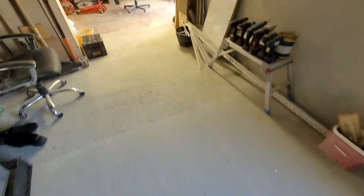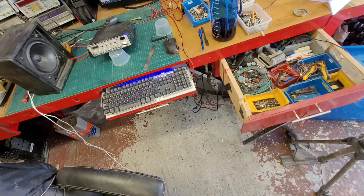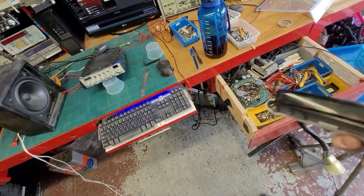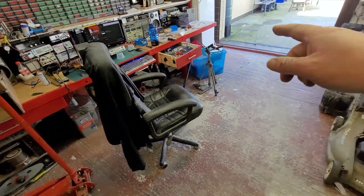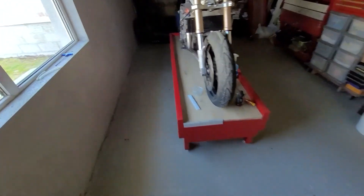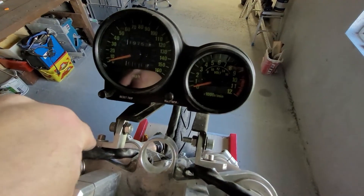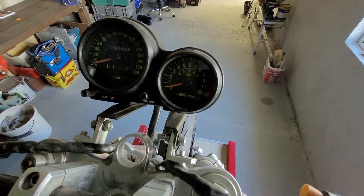When building something like this you're trying to think as far ahead as you can. I took the idiot light housing asunder and all the little colour plastic sections come out — they're just little square pieces of plastic. We're going to make our own housing out of aluminium that fits under the clocks perfectly and holds all of them, closing up that hole around where the ignition is going. I was going to put the ignition on the side of the frame but I think I'll just use the ignition holder that's there and put a collar around it all to cover everything up neatly.